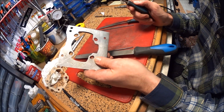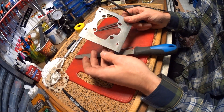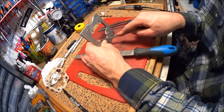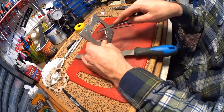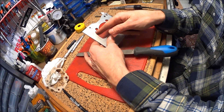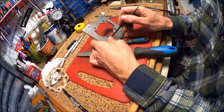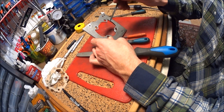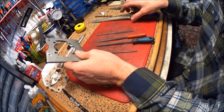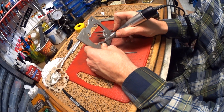You can do this with just hand files — it will just take a little bit more time than with a grinder tool. You get a set of different sizes. These small needle files are great for sharp corners and hard to reach areas, and the bigger ones are great for just hogging out material. You'll get a long way with just files, but with a dremel tool you can do it much faster. When you're done with the spacer, I highly recommend getting yourself a granite block or a thick piece of glass and some fine grit sandpaper to make sure that it's flat and level on each side, because these big sheets of aluminium aren't always as flat as they seem. That's how I do it, and I will make sure to show you when I actually make one next time.